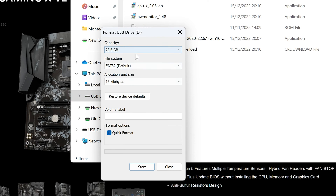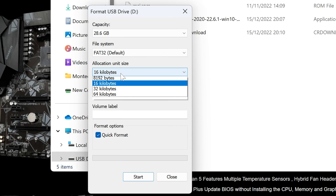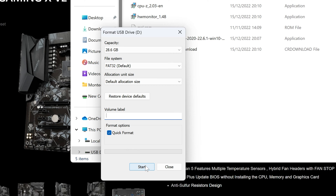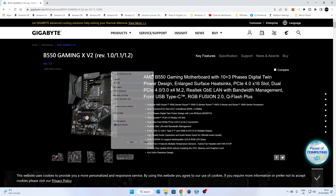The drive is 28.6 gigabytes in size. FAT32 has to be selected — if you don't have an option for FAT32 your drive is too large, and it won't work with exFAT or NTFS. Set the default allocation size to default and remove the volume label if there is one. Once you're happy there's nothing on the drive you need to keep, click Start to format. You'll get a warning saying 'erasing all data' — if you're happy click OK. Then you'll get 'format complete' and you can close down those windows.